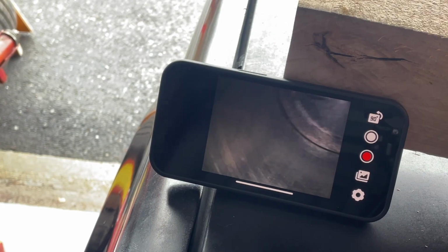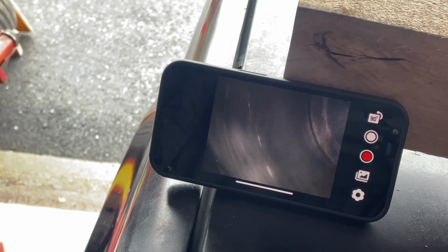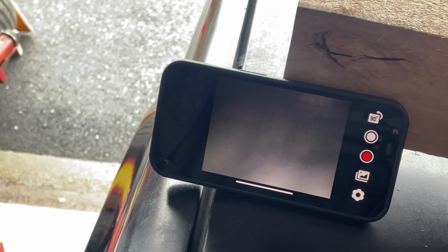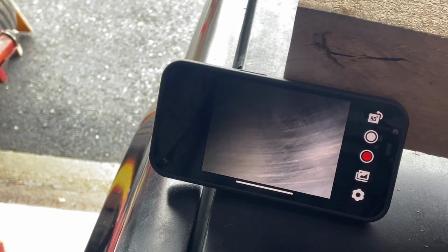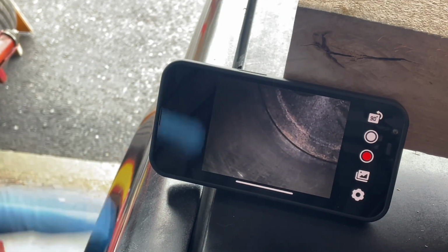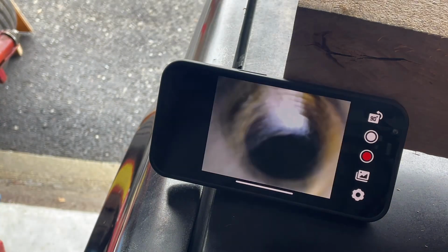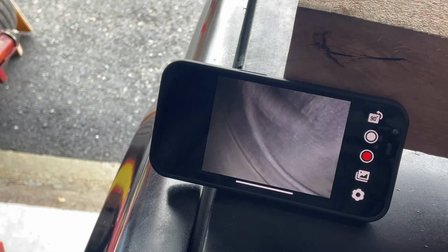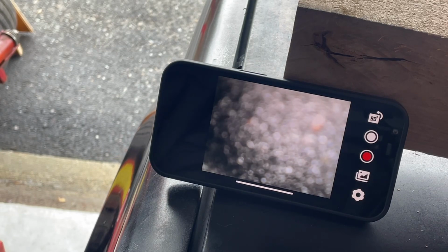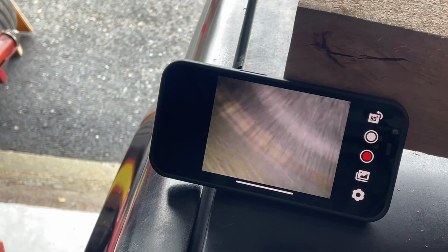The other thing I'd like to do is a cylinder balance test. Actually, compression test. That's why I wanted my tools. I brought my impact gun. This one looks good as well. I was hoping I could just put it on the crankshaft and rotate the engine fast enough to get a compression test. Anyone ever do that? It's either that or I buy a starter just to put on the stand and fire it up to a battery and get compression that way. So, haven't decided yet.